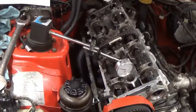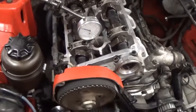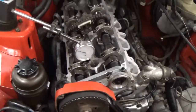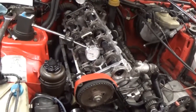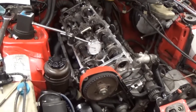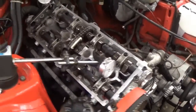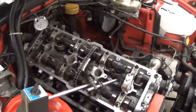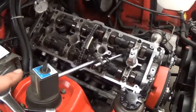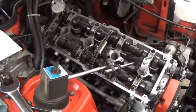What I've got here is a dial indicator going down into the spark plug hole, and that's measuring for top dead center — when the piston comes all the way up in its stroke. Pistons one and four move together, operating in the same direction on the crankshaft, and cylinders two and three are the opposite.